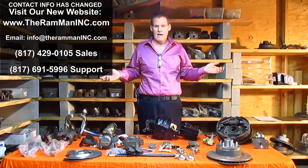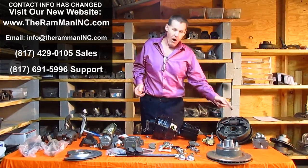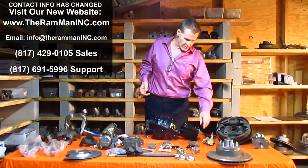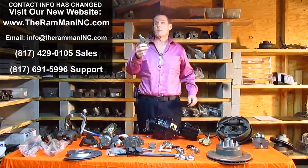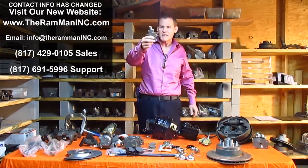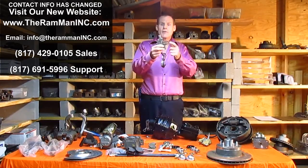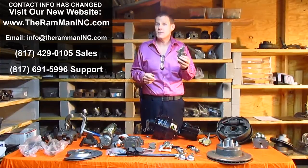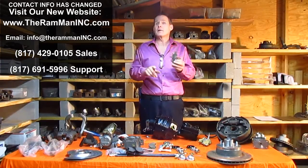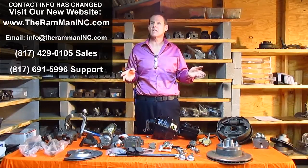That's why you will never find a disc brake car on the planet Earth manufactured with manual disc brakes, because it just doesn't work very well. All disc and drum cars came with proportioning valves — doesn't matter if it's Mopar, Ford, or whatever. They're not really proportioning valves, they're pressure reducers. They were all designed at basically a 250–275 PSI cut-in. In other words, they pass pressure through until they reach that spring cut-in point, and then after about 250 PSI, they cut the outgoing pressure by one half, greatly reducing it — in an attempt to prevent rear wheel slide prematurely.